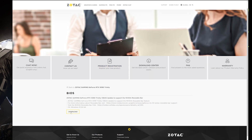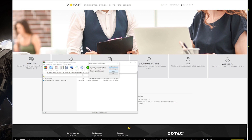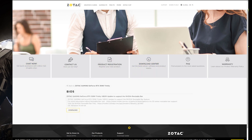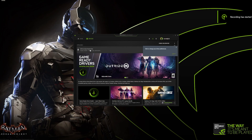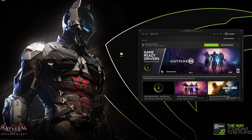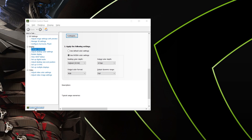Then we will have to download the BIOS for the graphics card for the Nvidia Resizable Bar. Save it somewhere you can access it and extract the content to a new folder that you make. I named mine 'VBIOS' and extracted it. Now we have to update our graphics card drivers to the latest version — you can use Express installation, it's faster.